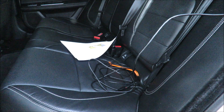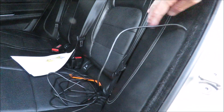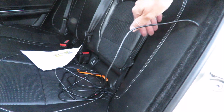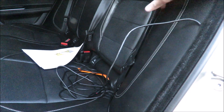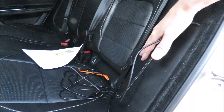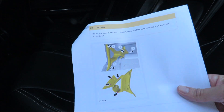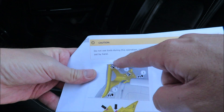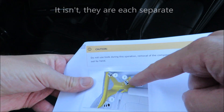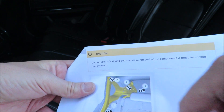So, it's the next day — I ran out of light yesterday and had to stop filming. The cable for the rear camera is sitting here. I tried to get this rear bolster off yesterday and I couldn't. The manual says that it comes off in the same way as the old XF, but I cannot see the release clip behind here and I can't figure out how to get this thing off. If any of you know how to do this, pop a comment below — I'd be interested to know. What I'm going to do is change my plans — I'm going to be taking the cable up through there. The manual actually shows you that this entire rear quarter panel is one panel, so you've got to first unclip this section here and then that section there, and then pull it away from the top and away at the bottom, and then it'll come loose.